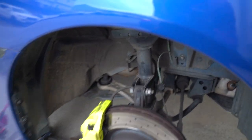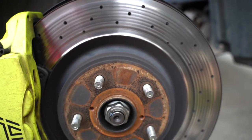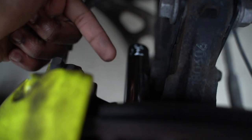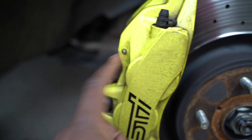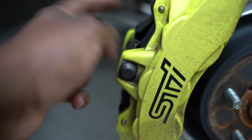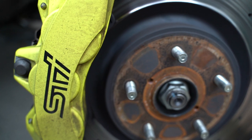We're going to continue. I'm going to show you guys what I did so far. I took the lug nuts out. The next thing I'm going to be doing is taking the rotors out. There are two bolts, one up here and one down there. Once it comes out, the caliper is going to come right out. I've got to take these pins out — there's one right there and a second one right below. Then take the bolt that holds this out, pop the clips out, take the pads and everything out, and then we'll be good to go.